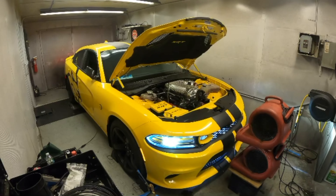I need to tell the tuner I want more pops too — it doesn't pop at all anymore. I'm going to park it on pavement so I can see if it leaks anything. Oil pressure is still good — reading around 50 PSI, didn't go any lower than 45 on the last run. Between shifts it dropped a little, but anytime I was on the throttle it was going up. That's exactly what we want to see.